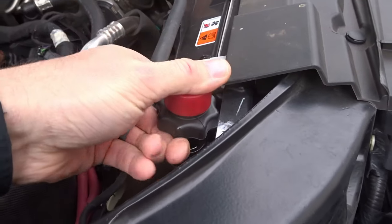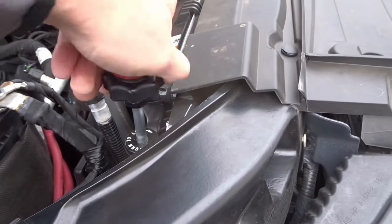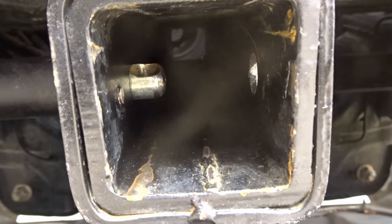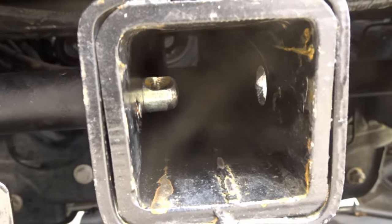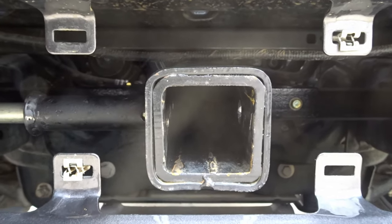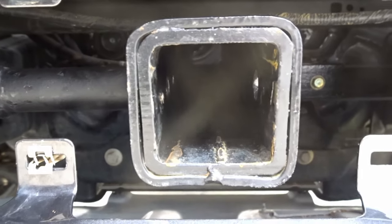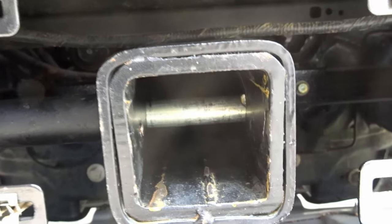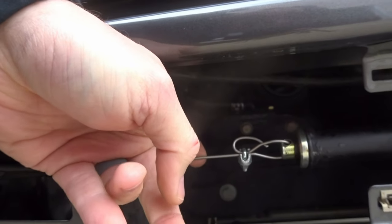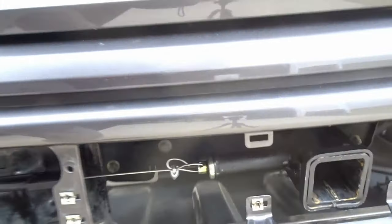So now with the pull of this vernier cable, and then do the fine adjust here. If you can't get a good enough pull, you can bring this pin in and out easily without having to get under the truck. Whenever your front hitch, whatever you got here, is plugged in, it closes nicely, engages. You want to get a cotter pin in there, there's still room. But this cable puts a little bit of tension, keep the thing from sliding out.